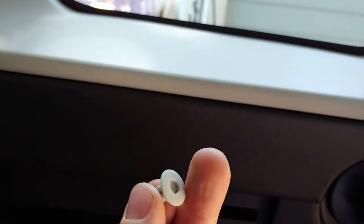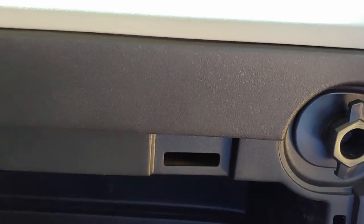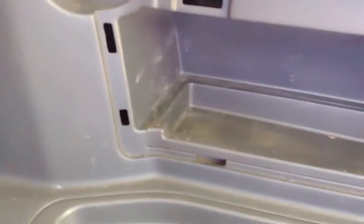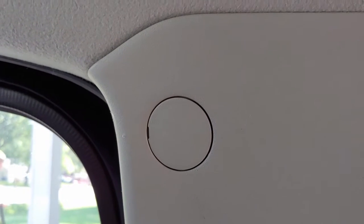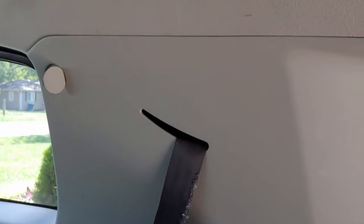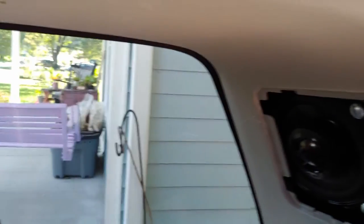If you haven't dealt with these fasteners before — you push it back out to this point to reinstall, slide it in, and then push it flat. The last one is way over here by the seatbelt itself. We're going to have to get under there and take that bolt out — it's a 10mm as well. Once you have all those out, you'll want to use an extension for this one up here because it's kind of deep. Even with a deep socket I needed an extension. Then pull this light gray section off — at this point it's just sitting in there with clips, so you just work your way around. It's a pretty snug pull, but don't feel too bad about it — it's sturdier than it looks.